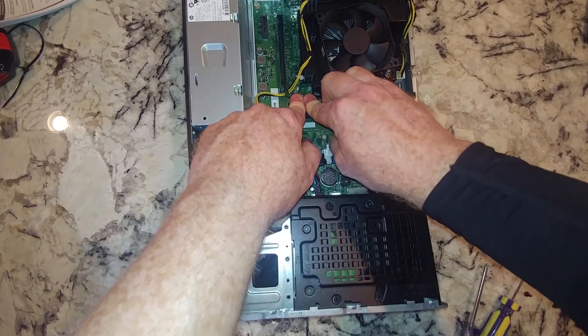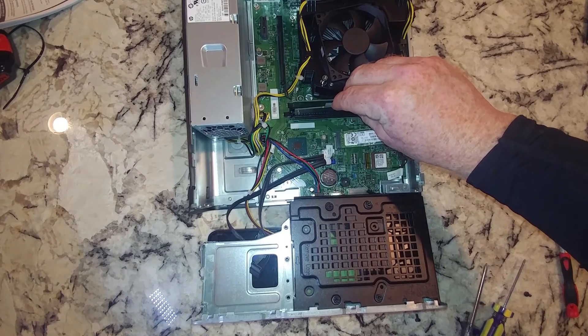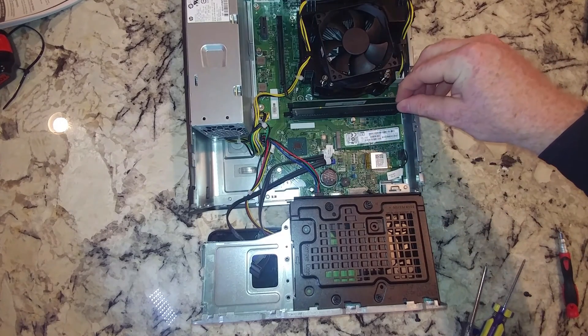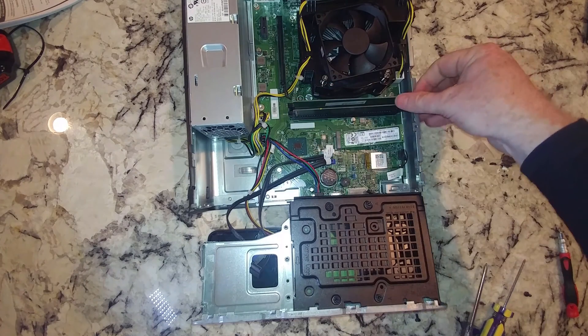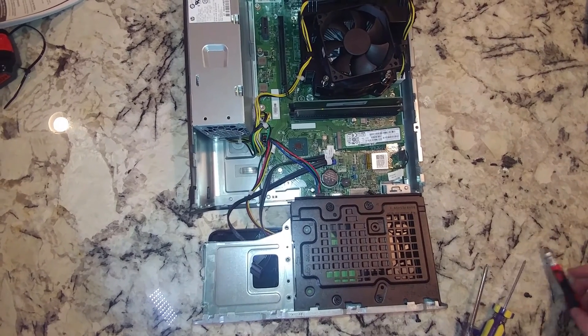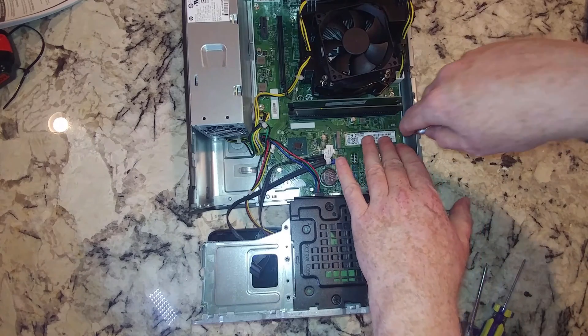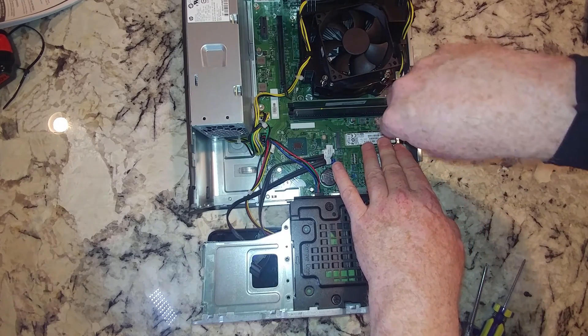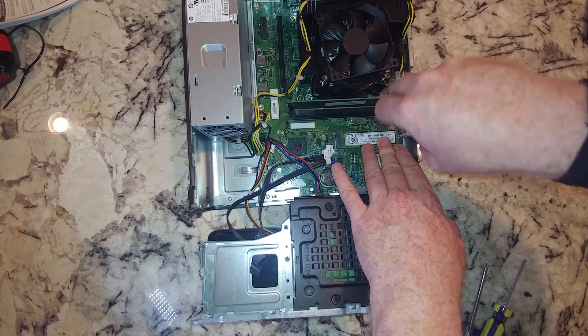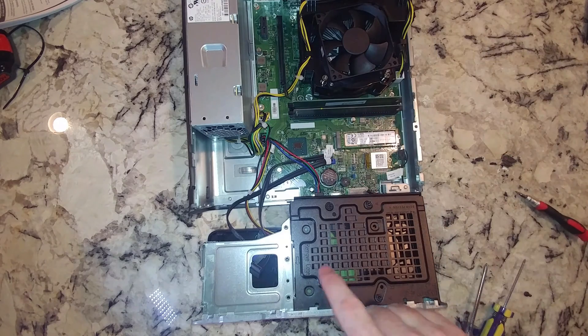Hopefully I'll note the specs down below, and if you're watching this, remind me. I'm going to put an 8GB stick in, which is going to make a huge difference on this machine. We're also going to go ahead and put a screw in that M.2. Normally I recommend a magnetic screwdriver to put these screws in, but this one's easy enough to access. I'll put that screw in there and we're good to go.